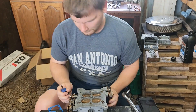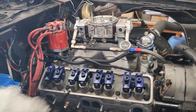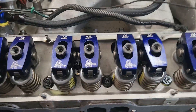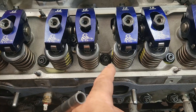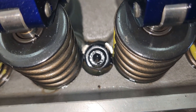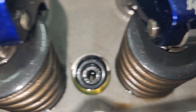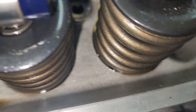Got Chris over here rebuilding the carburetor. I'm going to do these head studs — I'm just going to pull them out one at a time. Undo the bolt, take the bolt and washer all the way off, then put an Allen on the end of that and thread them out. Lube them up real good, thread it back in and re-torque it down.